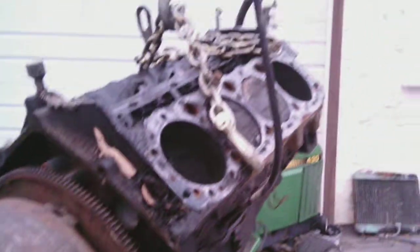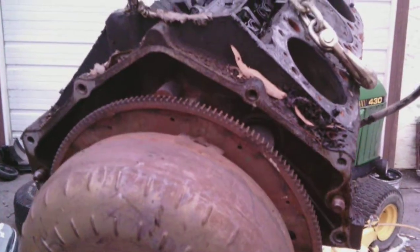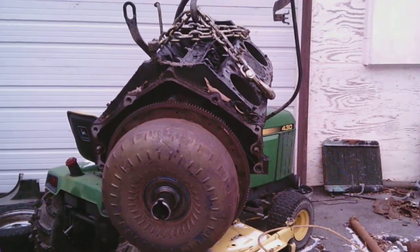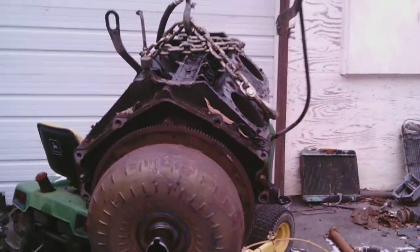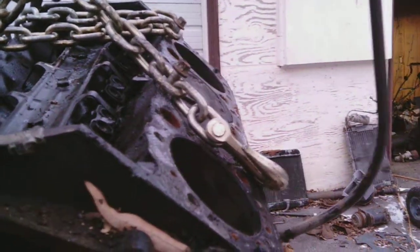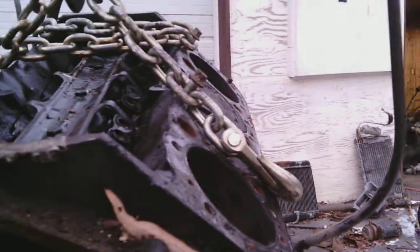That's nice. See, here's the bolts you would have had to take out. And of course, this is confusing. This is a 15 millimeter head, and there's three of them equally spaced. In general, everything that threads into the block is English bolt, and all the other stuff's metric bolts. Stuff that threads into the crankshaft is also English bolt, and it's confusing also because all the bolts on the intake manifold are metric bolts, except there's 2, 4, 6, 8. Those bolts that hold the manifold on are English bolts, and they take a half inch.